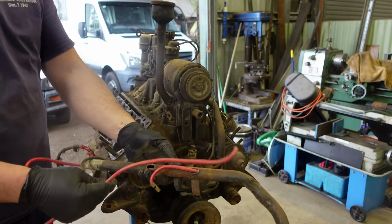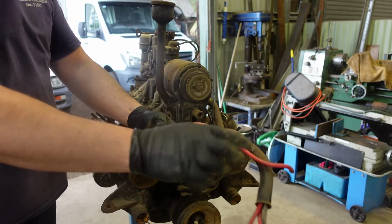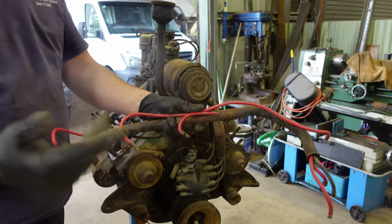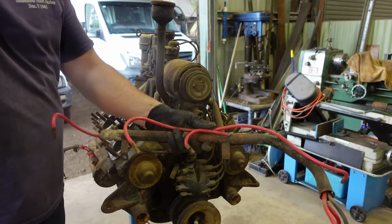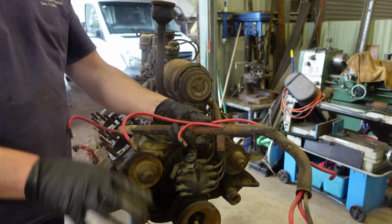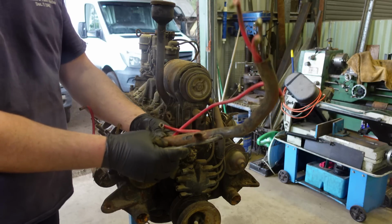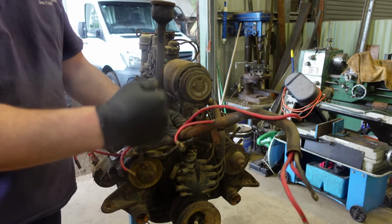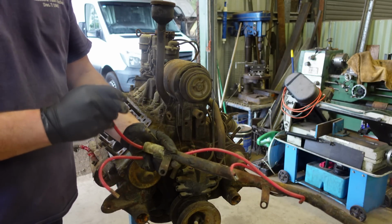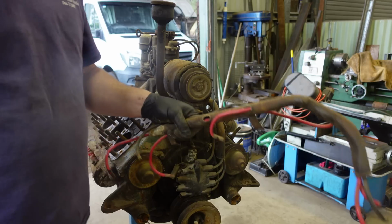Something about these, it obviously didn't do it because they're produced by the millions, but I know in the later silicon high tension or high suppression leads, at night, if you lift the bonnet on an old Cleveland or an old Holden or a Chevy or whatever, the earlier 70s cars, you can see a blue spark running down the entire length of the lead, and I just don't know how they'd go in these tubes all tied together. I know some of the later ones had a plastic clip and they were separated. They just clip into it and they were separated. But these running through a tube, maybe the old copper leads, because these are old copper ones. Maybe they didn't do it. But I know you sort of wouldn't do that to a late model lead, but let me know what you think.